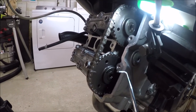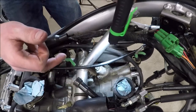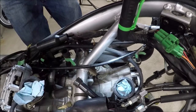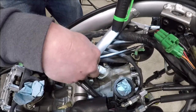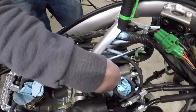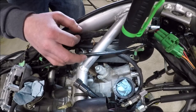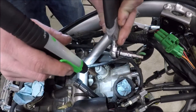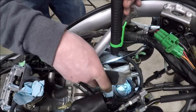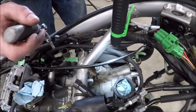This is one of the two things about this procedure that's got me worried. The other being the cam chain tensioner. The next thing we've got to do is remove this cam chain tensioner right here. Something I didn't see in the manual but I've seen in one video and some comment threads is that you want to make sure you crack this 10mm nut beforehand. So I went to do that and I couldn't get it to line up. Oh, it's hand tight. I don't think that was supposed to be that way but every time I think I know something about this bike I get a new surprise. Then you also need to get a 5mm Allen and crack and remove these two Allen bolts down here. Once you crack those, you're committed. You're pulling the cam chain tensioner out.